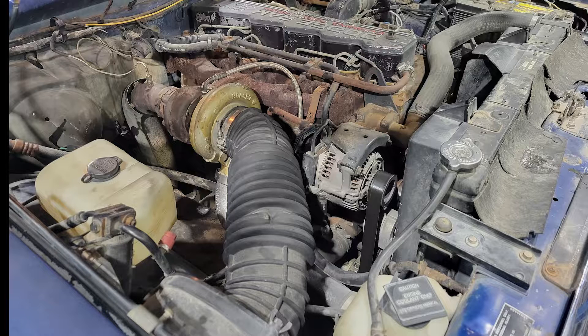Here is the photo of the new full HX35 off of an automatic VP44 truck — it's a 54/60/12-W, where W stands for wastegate. I threw that on today and it does spool good. For boost comparisons: the H1C made 21 psi of boost and this is making 19 currently, which is right on par with what the VP44 trucks make. The wastegate is blowing open at 18 to 20 psi, so I'll need to adjust it up to around 30 psi. I also need to make some AFC adjustments to get more pre-boost fuel — your star wheel adjustment — because the fuel comes on really hard once you're way into boost but needs to come in a little earlier for cleaner, better manners.